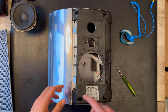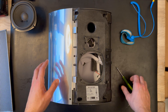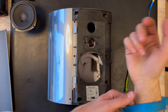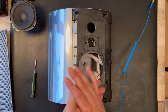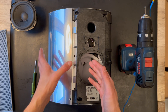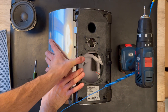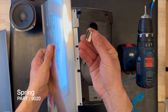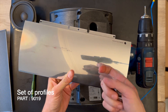Next we're going to take the cover off — remove all the screws on each side. Remember to ground yourself first as we are now working with electronics. I've now removed the screws from the aluminum side. To remove the aluminum panel, just press it upward — it's held by two spring clips. Here is the aluminum plate.